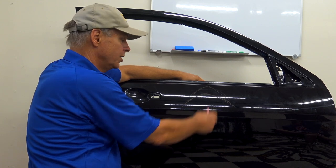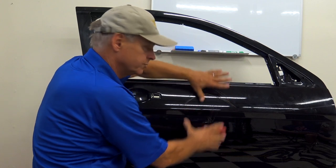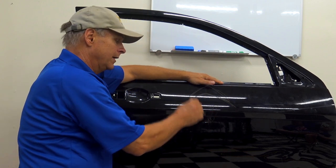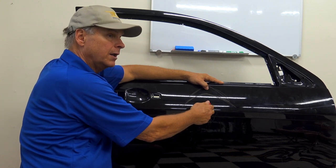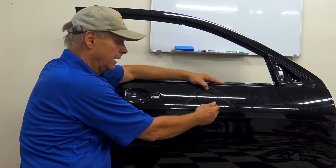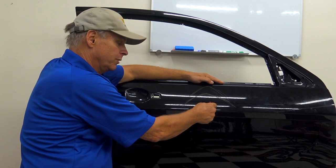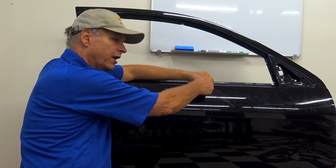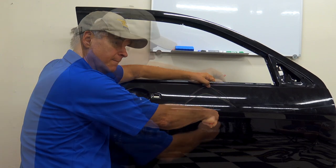You don't want that, guys. You want to move all that right into the body line, top and bottom crown into the body line. Now, having said that, I will put a tab on my body line, usually, especially when they're hitting the body line, some kind of a tab across there. But I do that for the sole purpose of getting the crown energy to move into that body line area.